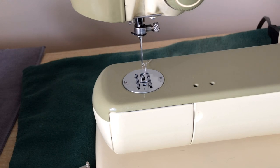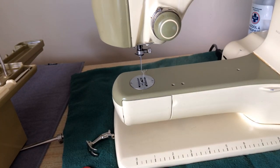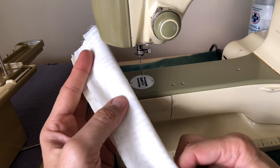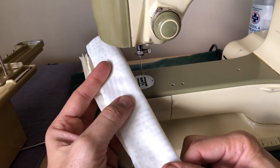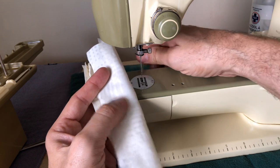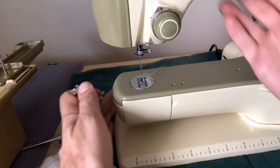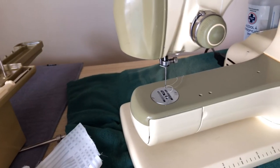So why are we doing this if the machine hasn't been overhauled — why are we going to run it? We're doing this because what we're trying to figure out is: are those gears cracked? This is not 100% foolproof, but it's helpful. If I can make a series of stitches without an interruption, that is one indication that my gears are probably okay. Before we do any sewing, of course, we're going to install the foot — and this might be a good place to show you how to install a vintage Bernina foot.